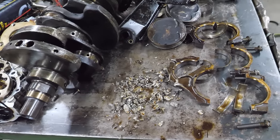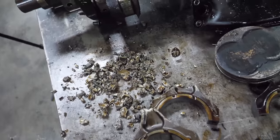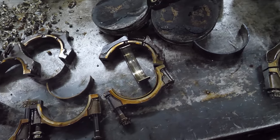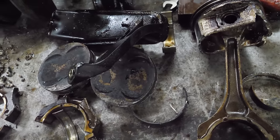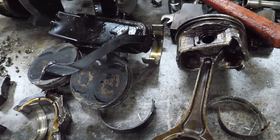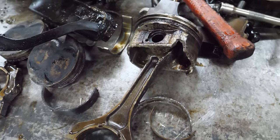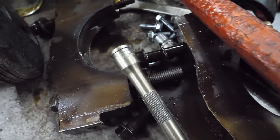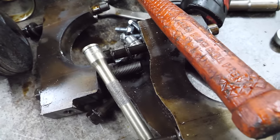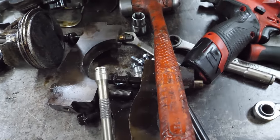Let's just take another gander at all the damage here. That all came out of the pickup. This is the surviving big ends of the rod. A couple piston cupcakes, not the full deal. This is the only one that survived, and well, we'll use that term loosely. Also, looking at the main caps, they clearly got hot too. They're discolored. Not all of them, just some of them.